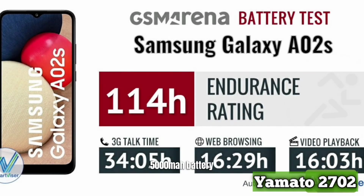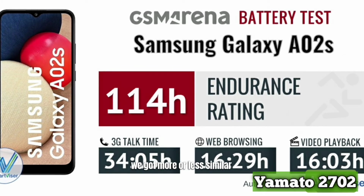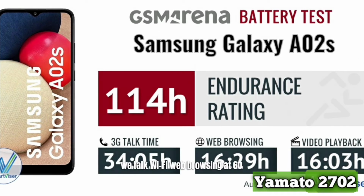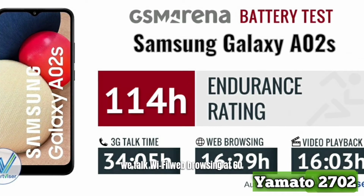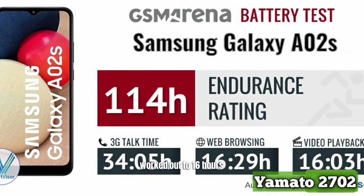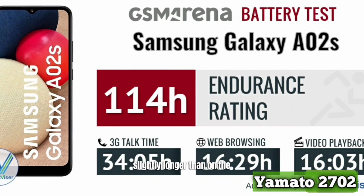There's a 5000 mAh battery inside the Galaxy A02s, same as in the A12 we had here a couple of weeks ago. We got more or less similar endurance out of the A02s too. We clock Wi-Fi web browsing at 16 hours 29 minutes, while video playback in airplane mode worked out to 16 hours flat, both numbers ever so slightly longer than on the A12.